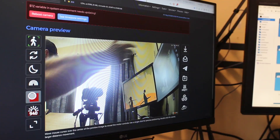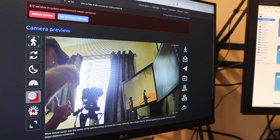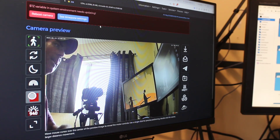Configuration complete — your camera is rebooting to connect to the wireless network — and it gives me the MAC address for the camera. It rebooted; I scanned my network for new devices and found one. I did an NMAP scan on it: port 22, so SSH is open; port 80, which is a web server; port 554, which is for streaming video; and port 8089 which says unknown — I'll have to look at the documentation. Let's go ahead and go to that IP address in my web browser. It did pop up a username and password request, which I filled in. There's no encryption right now so anyone on your network will see that traffic. It's giving me a message about the $TZ variable — I'm assuming time zone — needs updating.